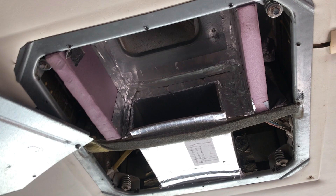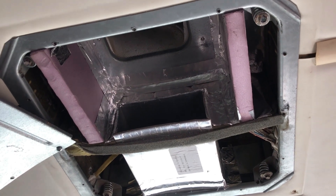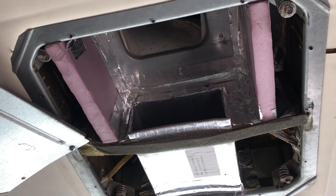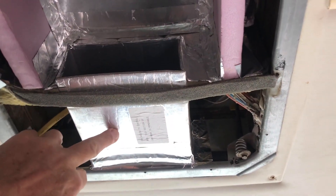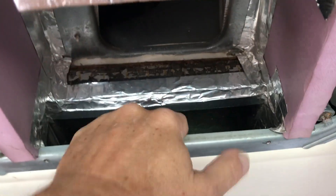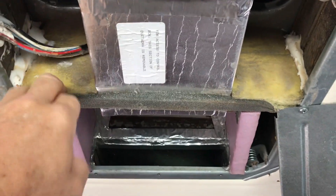This is the bottom side of the air conditioning unit inside our rig. This is a 2008 Fleetwood Revolution, and one of the things they did with this rig was put vents going in two different directions, so they had to put this box in. This box allows airflow from the downcoming air to go both ways, facilitating flow past the incoming air which flows up through here.